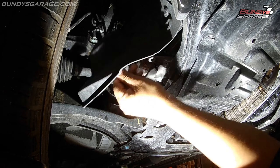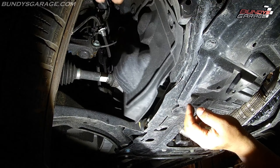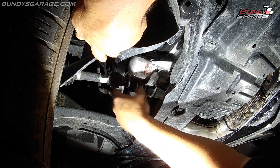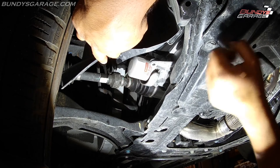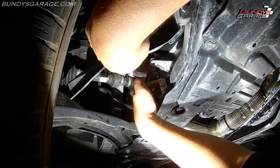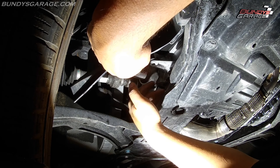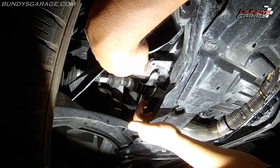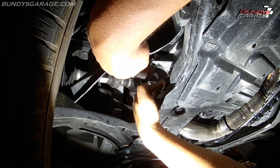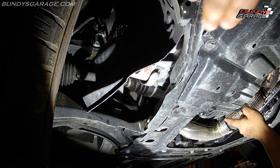Right there behind this shroud is the oil filter. Let's see if I can pull it out — no, it's too tight, so you need to get an oil filter wrench. If you don't have an oil filter wrench but you have big channel locks, you can actually get in there and grip onto it to pull it loose. Since the subframe is right here, I'll stick a piece of cardboard or plastic under here before loosening the oil filter, because oil has a tendency to drip into your subframe. Guiding the used motor oil over the subframe with cardboard just makes the job that much cleaner.